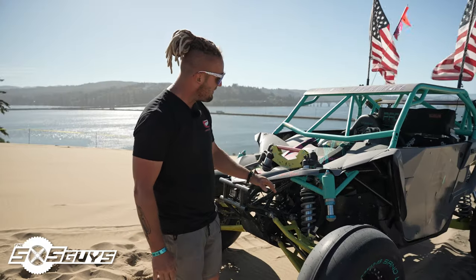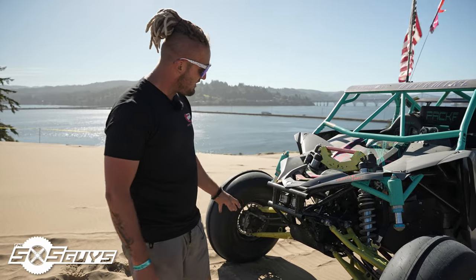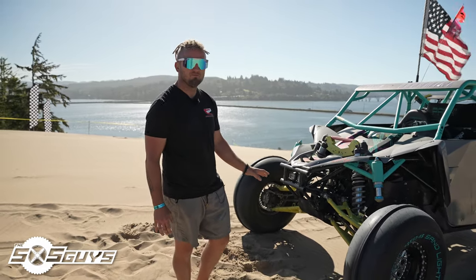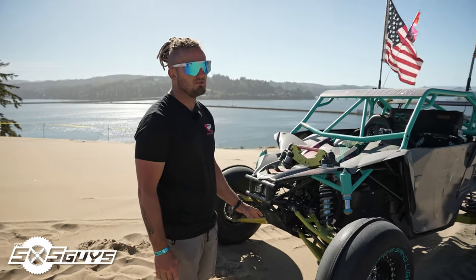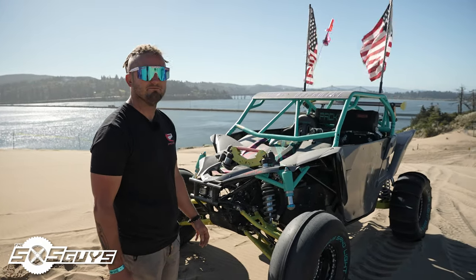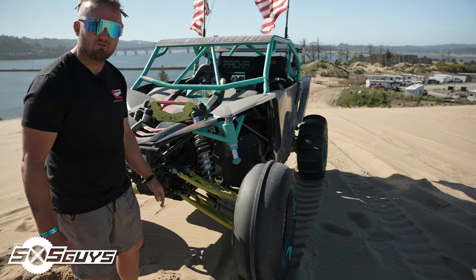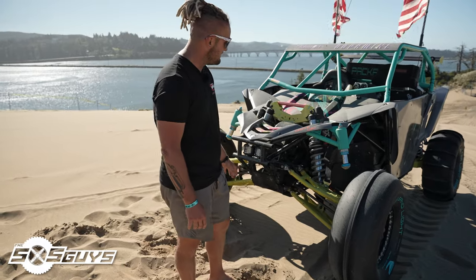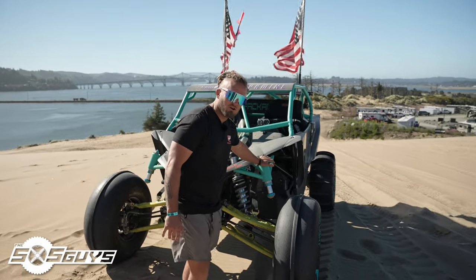There's no radiator up front anymore — the radiator's in the back. I've got the diff that's still four-wheel-drive capable. I jump in two-wheel drive, but I wouldn't mind jumping in four-wheel on some of these jumps — you just haul to the spec wheels. We've got limit straps in the front end because it has too much travel for the axles and gets axle bind at full droop. The King bump stops are a two-inch stroke, two-and-a-half-inch diameter.